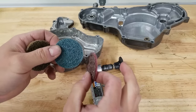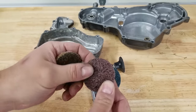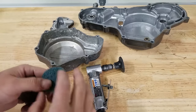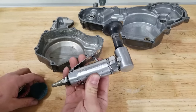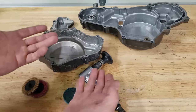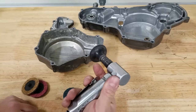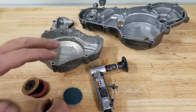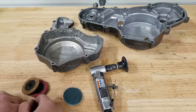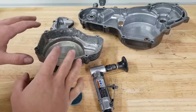You don't want to go heavy on these things because it'll actually take the aluminum down — it's almost like sandpaper. As long as you do it gently and keep it nice and flat, you shouldn't have any problems. These are fairly cheap tools; if you're doing motors all the time it's definitely worth the investment. This Ingersoll Rand does need an air compressor, but they do make electric die grinders. Milwaukee makes one for about 200 bucks — I'll have all these tools linked in the description below. I might be able to find a cheaper electric one, but I won't recommend it because I haven't actually tried it.